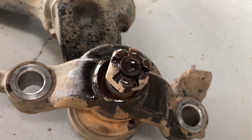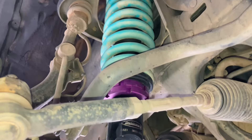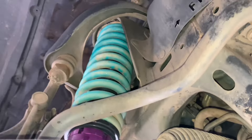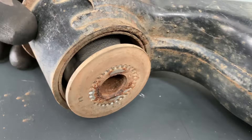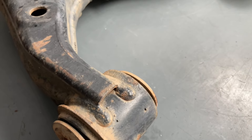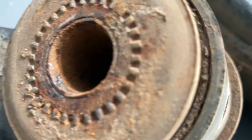Remember, you've already loosened that nut, took the pin out, and I've sprayed some Inox on there. Let those sit for a bit. I'm going to lower the vehicle a little so I can reach that top nut more easily. Let's see if this whole strut drops straight down. Here we are at the bench — look how bad they are, just off their heads. You can see where that one got hit, where the frame even got hit. You don't have to straighten that, but I'm going to do a little bit of work on it. The bushes are definitely due for replacement — overdue, and the longer you leave them the more damage occurs.